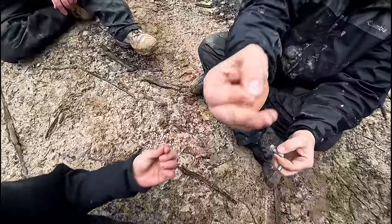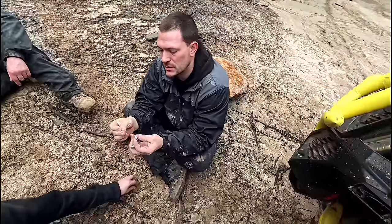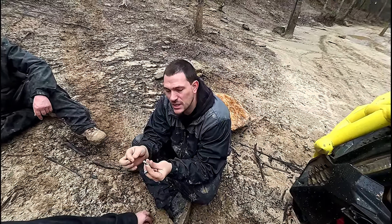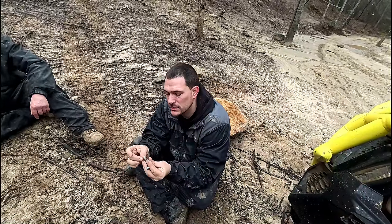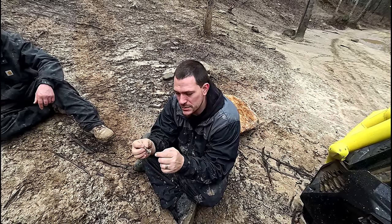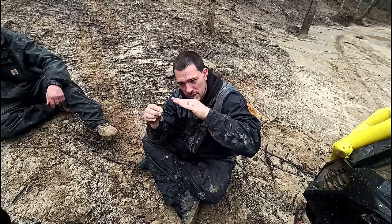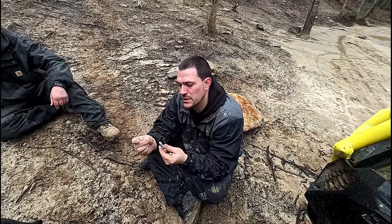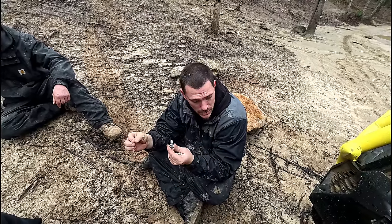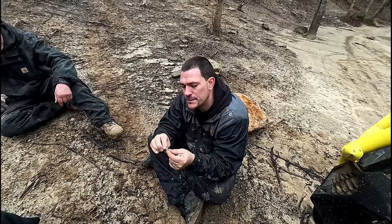Oh, I can see it there on the ground. Can you see it right there? So I don't want to chance it. We noticed when I backed off that, we noticed a kind of thud, or I don't know what the noise would be called, a tick. And they noticed that these bolts were still in, but they were loose, and the diff was going like this, and it ripped a few of the threads out. So rather than chance it, I must have just not tightened them up the whole way, and it must have been in there just a little bit, and it ruined some of the threads.